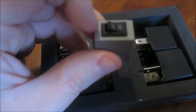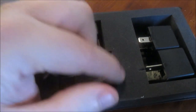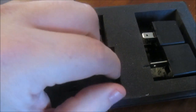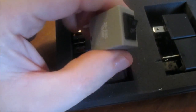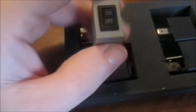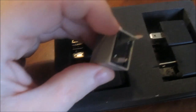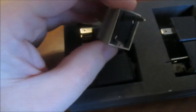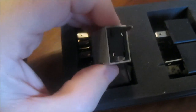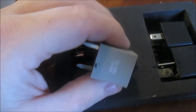That way you can figure out if you've got a control problem or if your load side is working. I've made a lot of videos where you see me pull out a relay and stick some wires in there to manually bypass it. I think this type of setup is a lot safer, because in a lot of scenarios if you bypass your relay wrong and short something out, there's a good chance you could take out your computer driver or whatever is turning the relay on.